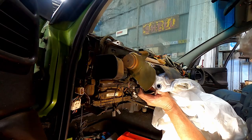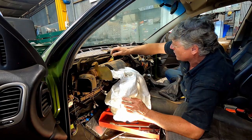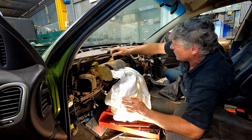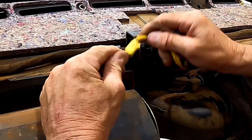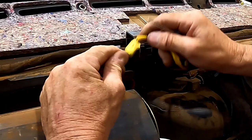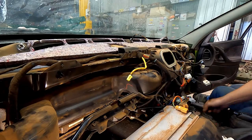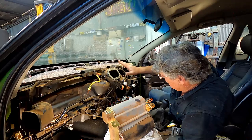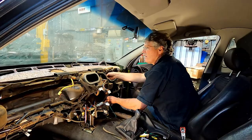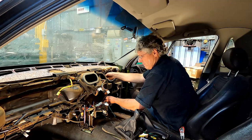We don't want to damage the wiring. There's a little spring-loaded latch — push him in. That's the beast, it's out. Now we've got to get this fellow out — that's the next little chore. Given there's all this dust in here, I'm guessing the evaporator's going to have a fair bit of dust in it as well. Well worth pulling it out and giving the whole car a freshen up. It's just a big jigsaw puzzle — we're learning how to put it back together by taking it apart.